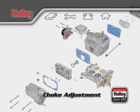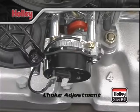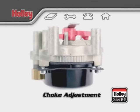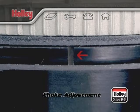The choke controls cold engine startup. There are two adjustments on an electric choke. You can control the choke operation by rotating the choke cap. Notice there is a center pointer and index marks on the choke mounting and an index mark on the thermostatic choke cap.